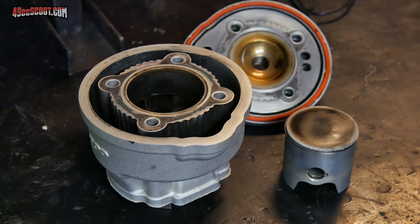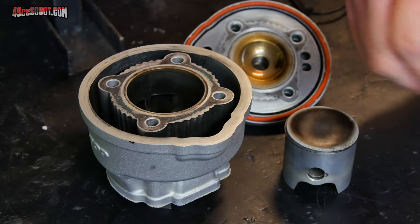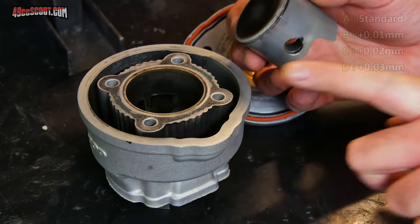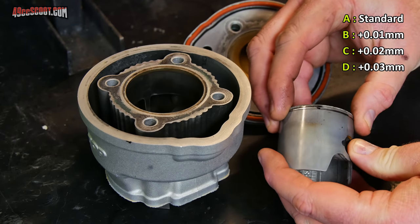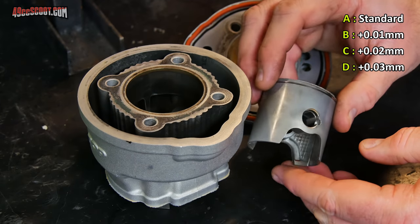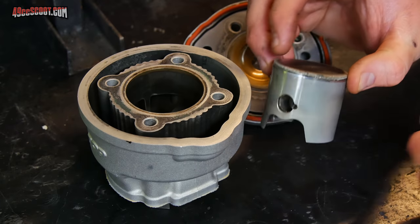It has, let's see, 474 miles on this cylinder right now, the whole kit. So maybe it'll need the same piston it had, but this was a B cylinder and B piston from Top Performance. They don't stock B, C, or D that I know of. Last time I asked, it takes 4 to 6 weeks to get a hold of anything other than an A piston. So it's probably going to be a while before I can get this back together.